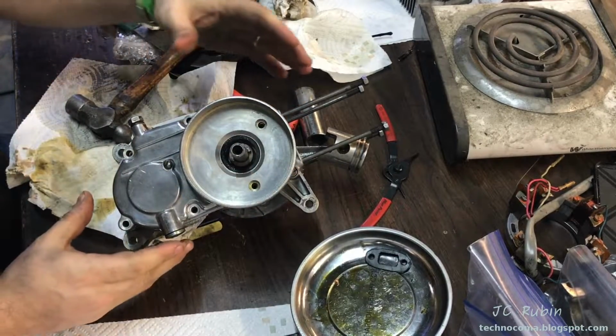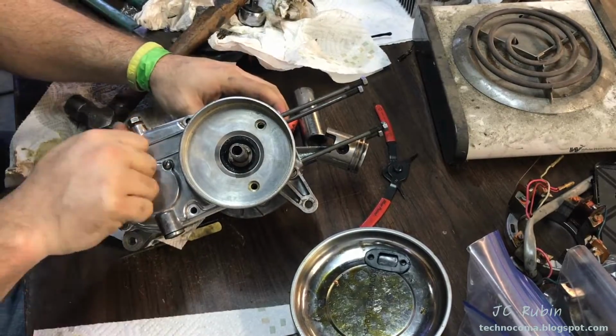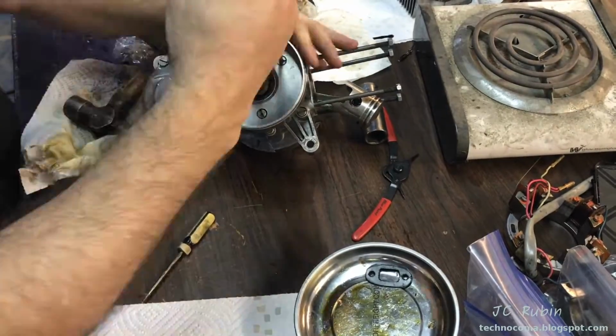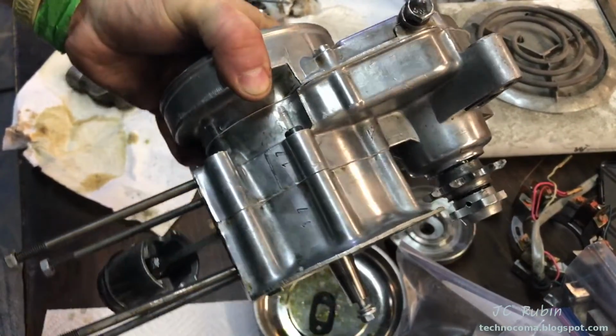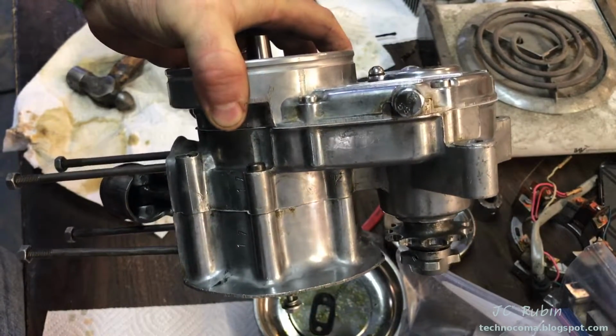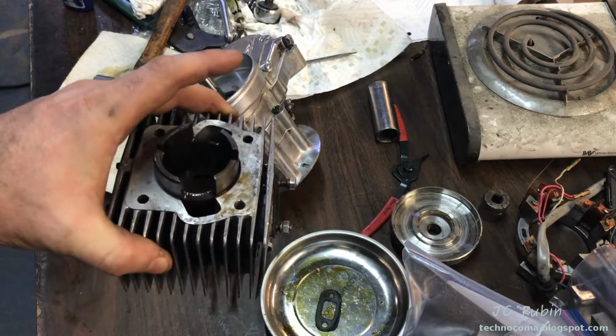Yeah, I could probably bring this down progressively with screws. Look at that. It is starting to look like an engine again. I have to take those screws back out and then put Loctite on all of them, put them back in and torque them down. We're going to put the cylinder back on with the associated gasket.